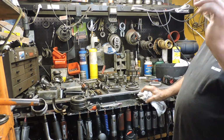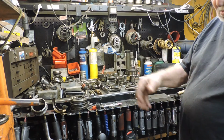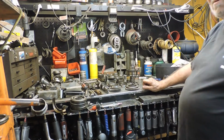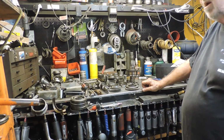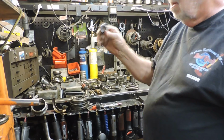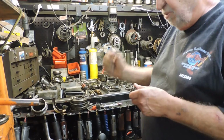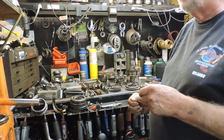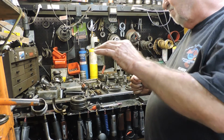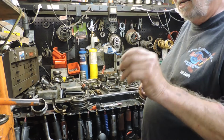I know you can jam it in first gear and all that. I always came to a stop before I put it in regardless. I think that's the best way to do it. It saves a lot of pain, and whatever you do with this little reverse gear, stop dead, push down, pull over, put it back, leave the clutch out slow, and sometimes you'll feel the stick going on back. That's what we call walking it in.